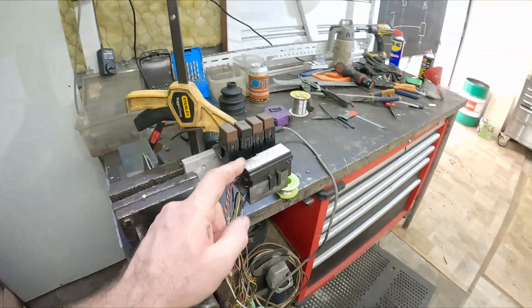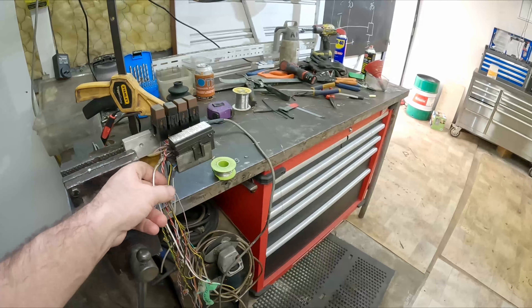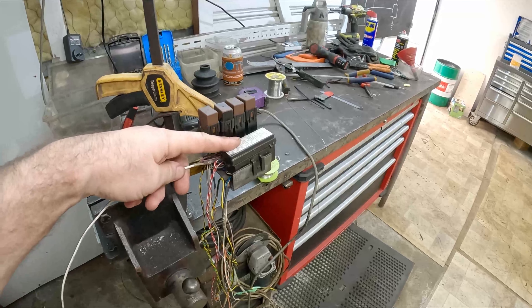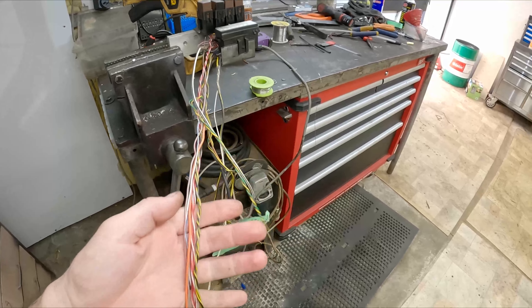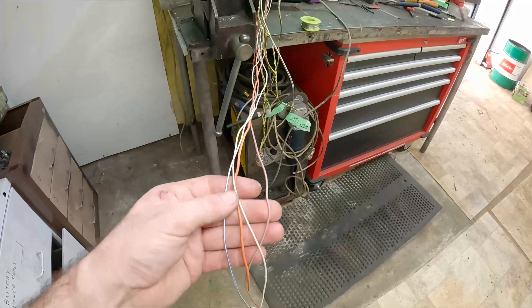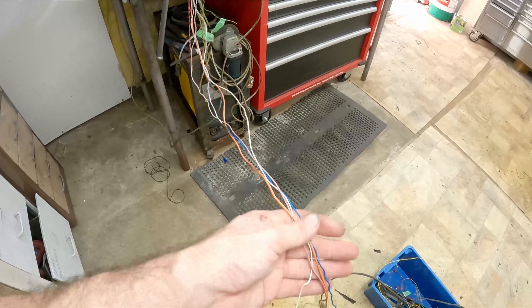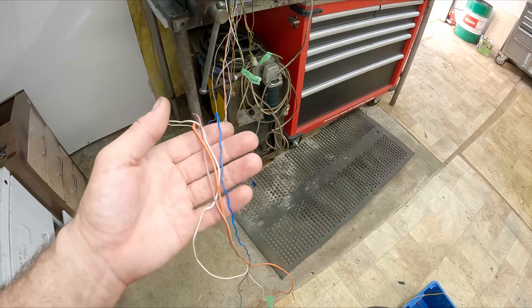Why do they do it this way? There's less load on pulling the ground than there is in giving it power, so we can make ECUs lighter, cheaper, and use less power. Obviously we've also got to have fuses. So what happens is we have our battery 12 volts, goes into our fuse block, into our relay. Then we have things coming out: the fuel pump and thermo fan. These wires will go directly to the ECU for fuel pump control, thermo fan control, and everything else. Let's mount these and make those connections at the ECU.